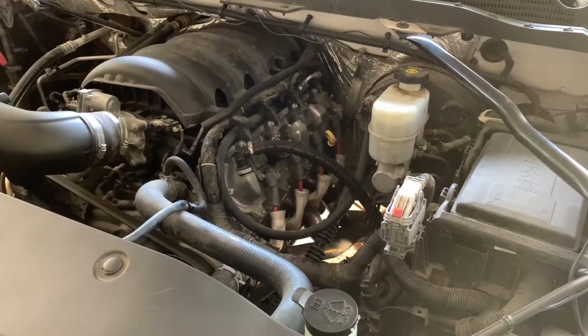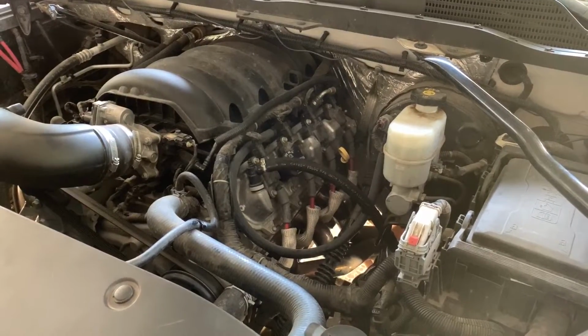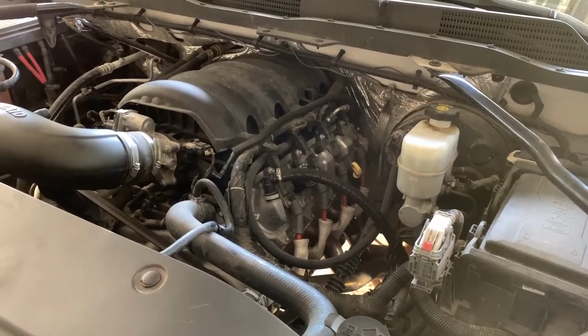When putting the new motor mount in, remember to snug up the bolts on the block of the engine first so the plate sits flush, but leave the chassis bolts loose so you can move the engine a little bit more when changing the other motor mount.